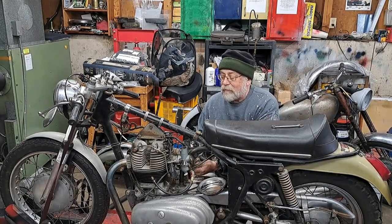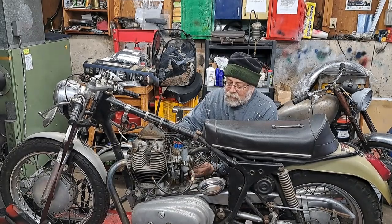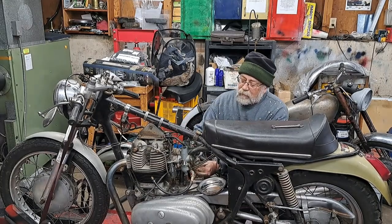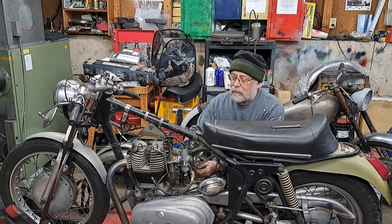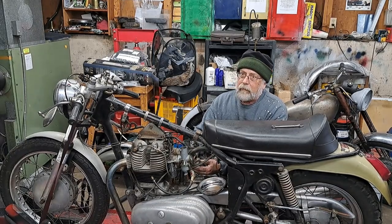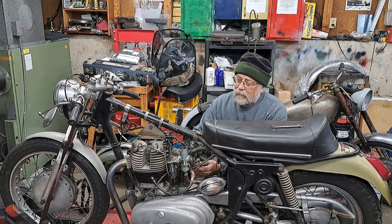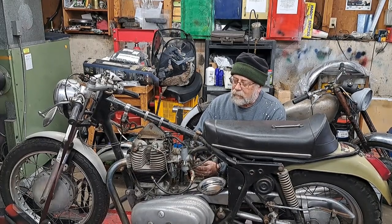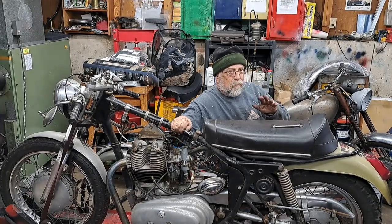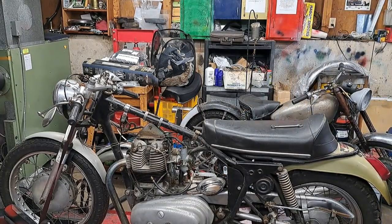Usually you can find something that fits, but like I said, these carburetors have a peculiar sized banjo bolt on the bottom that holds these fittings on. And there's nothing that I know of that'll fit on there except that 1/4 inch BSW or a crescent wrench, you know, an adjustable spanner or something like that. But bear with me while I get this unscrewed. And I'll show you what this little assembly looks like. Meanwhile, I'm just going to pause. You don't want to bother watching me unscrew a couple of bolts. That just takes too long.